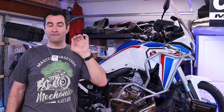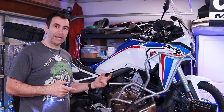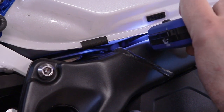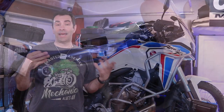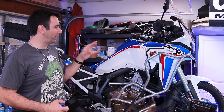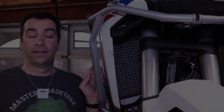Because it's the very first 8,000 mile service, get yourself a flashlight and look through here — you're gonna be able to see the main fuel line and all the other fuel lines that come out from the tank, so you don't have to remove the whole thing. That big fuel line I'm moving right now is the one they're telling you to check. If you look further down you can see the lines coming down from the fuel tank. As I'm looking in there, everything looks pristine — because it's a 2021 bike, it's 2023, less than two years old and it's a Honda, so the rubber of those hoses is not gonna go bad in a year and a half.